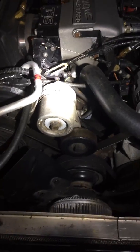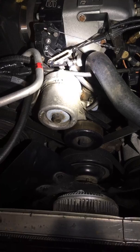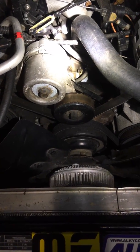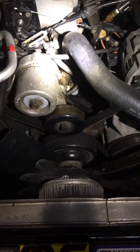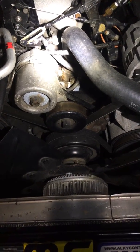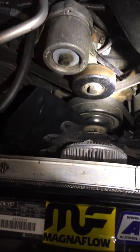And then the final thing of everything on the list, if this thing stays together and I don't blow it up, would be the brakes. Going to do the LS brake conversion, front and rear. And just dump the fluid out of the diff and put in some nice heavy-duty Lucas with some GM additive and a nice billet cover, a TA cover for the back. And that's it. I'm not doing anything else.